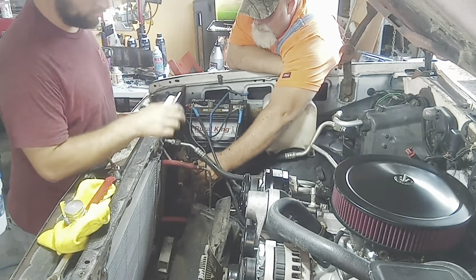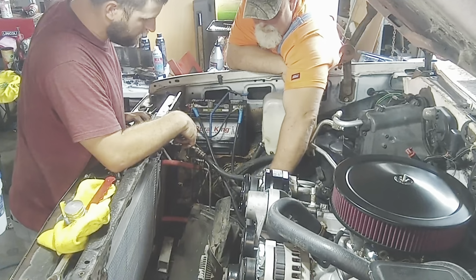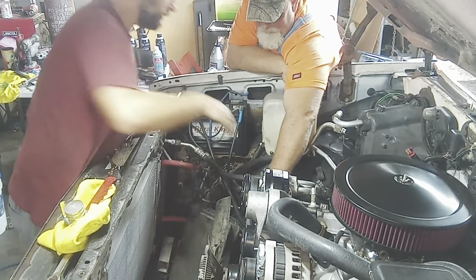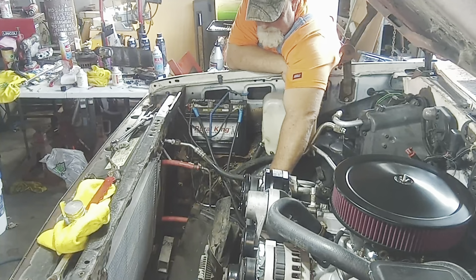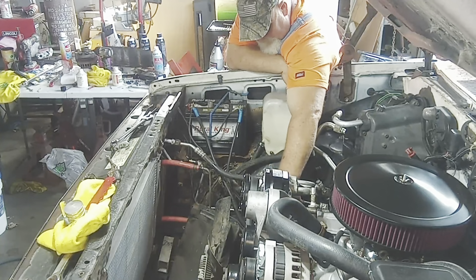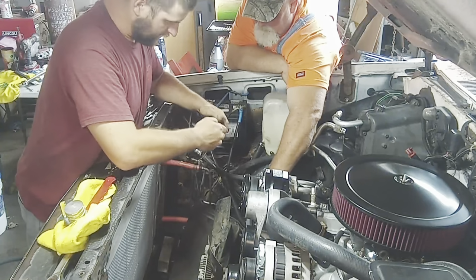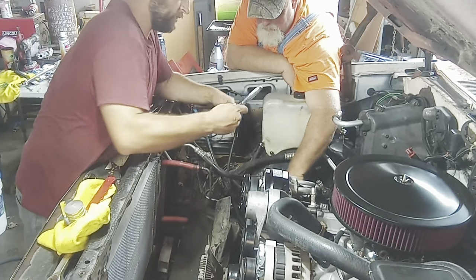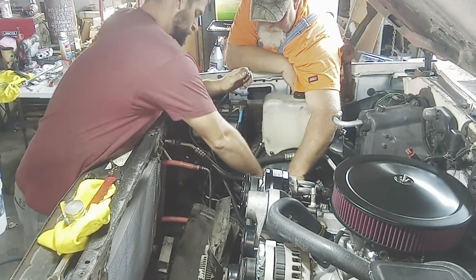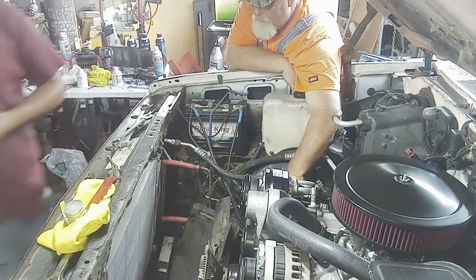So the problem we're having here is the condenser. The one they sent me came down at a 45. You got the socket for this? Yeah. The size is 3/8 or 7/16. So I gotta get an O-ring for this one. And mine's supposed to be on a 90. That's what I was saying. So we gotta make the hose fit the new condenser. It's a 10. Metric standard.